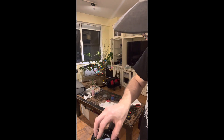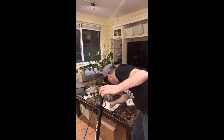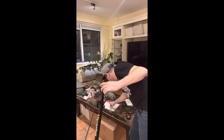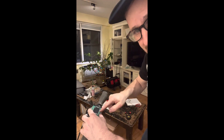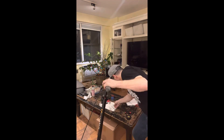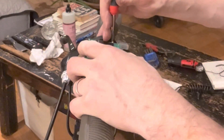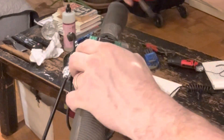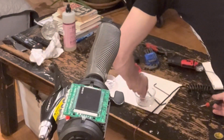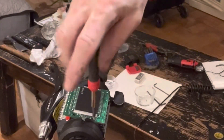The scooter will not work unless this is in place. Then there are four screws that hold this in — two long and two short. Pay attention when you're taking it apart. The two super tiny Phillips head screws go in these two holes right here. They're really tiny — if you drop one, I would put a towel on the scooter because that little screw can slide away and you're going to have a hard time finding it. Get both tiny screws in place.